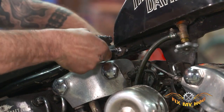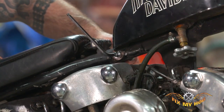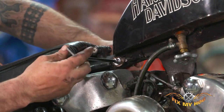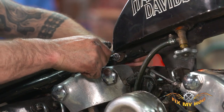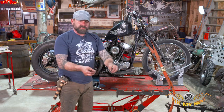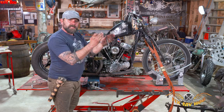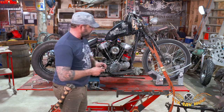Once it's loose enough, I should be able to start spinning it freely. It is a lock nut, so any time you use lock nuts, remember they have that plastic locking mechanism — you have to get them quite a ways off before you can finger-tighten them off, because that plastic does cause some friction, which is what it's designed to do so your bolts don't come loose. So there we go — that one's free. Now this is step one of disassembly: keep all your parts in check. Don't just have a big bucket of nuts and bolts and throw this stuff in there and forget what went where. Lay them out in sequence with all the hardware right there, so when you're ready to put this back together in reverse order, everything's in place.